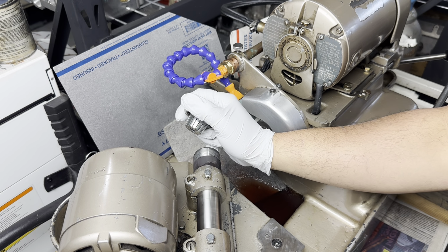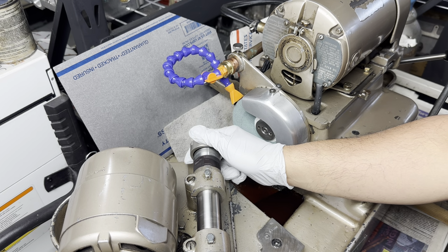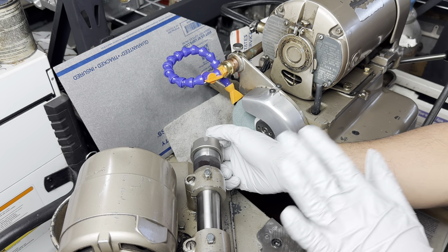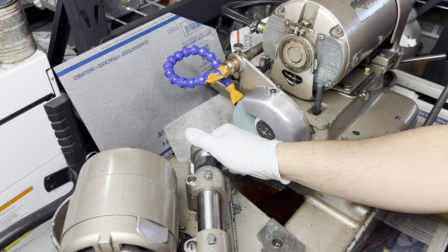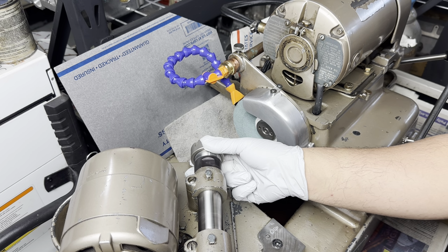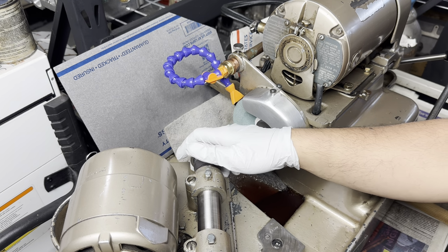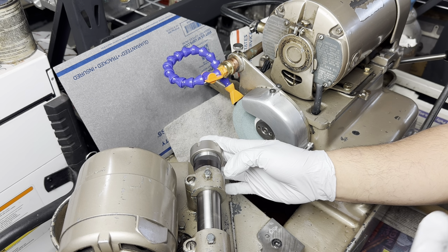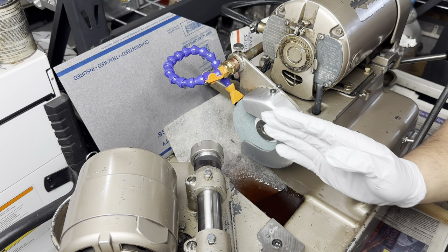here. I always wipe a clean finger on the inside of the hole and make sure there's nothing dirty on the inside of it. I also, off camera, blow out the collet and make sure it's free of dirt and oil. Oil on a collet setup is the enemy because it will attract dirt. Dirt causes things to be inaccurate. Inaccurate valves are a problem. This isn't rocket science. Again, don't suck.